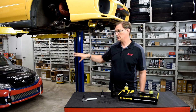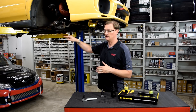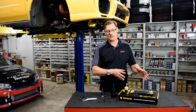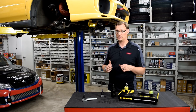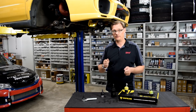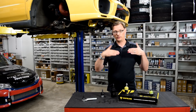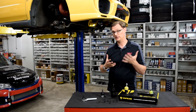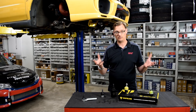As the car is sitting stationary, what you want to see is a down-slope angle of those lower control arms, just like this, so that you know it'll work properly. And that's what this brings back to you. Whiteline has also designed a tie rod end to go along with this. From my personal experience when I first put these coilovers on years ago, the steering felt really heavy, almost bound up, and I quickly realized it was because I had lowered the car enough to where the suspension geometry and the steering rack geometry was not optimal. Putting this Roll Center Adjust Kit on basically fixed all of that, and it was a very noticeable difference.